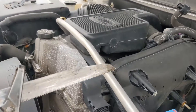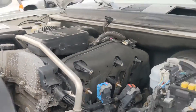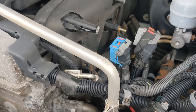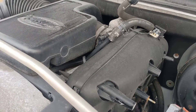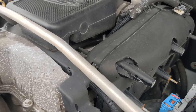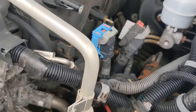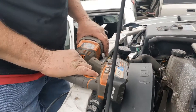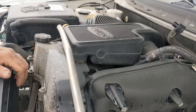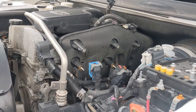So you've found yourself a 4.2 with an aluminum valve cover in the junkyard. The engine is in questionable shape — anything that comes from the junkyard got there somehow. These 4.2s don't give you access to the valve cover bolts on the intake side, and you need to take the valve cover off to get to the head bolts. So you've got to take the intake off, but there's not a lot of room. We recommend using a battery-powered sawzall to cut the intake off and then get your valve cover off — it'll save you a bunch of time.